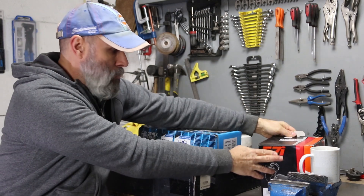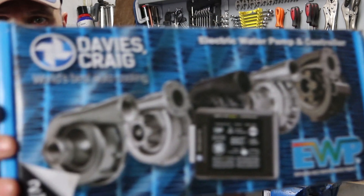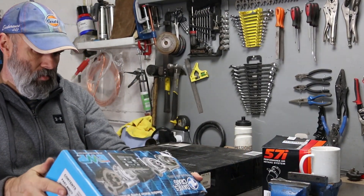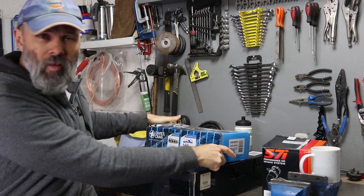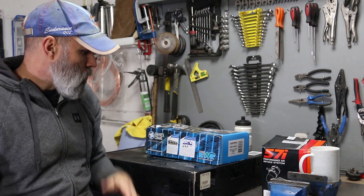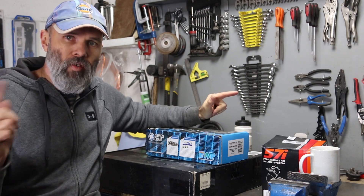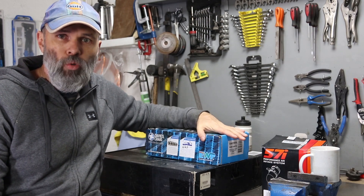So what other things? First of all is a water pump kit. This is a Davies Craig electric water pump — I think this is the EWP150, which is the one specified for turbocharged engines. If it's not turbocharged then you'd go a lot smaller. There are two reasons for getting this; one is slightly controversial: it takes the load off the belt system on the engine that would otherwise be required for driving a mechanical water pump.